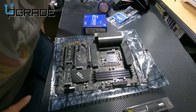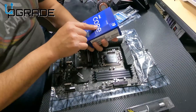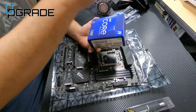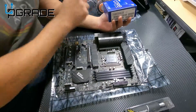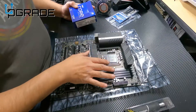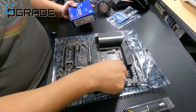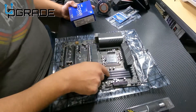Let's take a look. What I like to do every time is install the i9 first — that's very important. I make sure I do it properly so I don't have to readjust it mid-build. Second, I mount it in the system with the water cooling mounts. Before that I do a dry run to make sure it's running. Then I set up the M.2s at the same time. We're doing memory later since it's being used by another system.